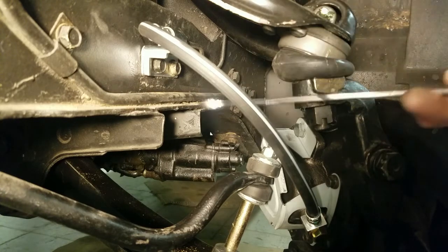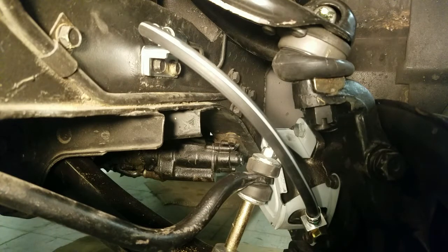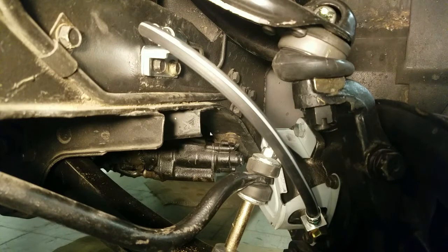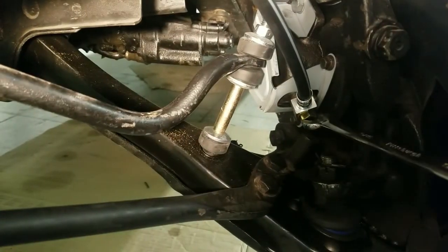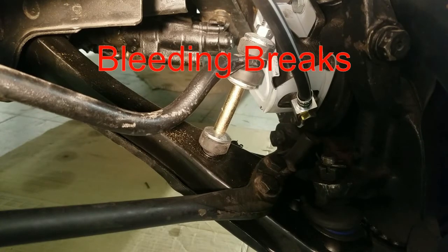Well, right now I've made sure that I've tightened that down, and that down. Those are both 1/2 inch into the frame. I used a 7/16 socket to get the brake line on there. And this down there is a 9/16 right down here on the brake line. That's all tightened up and good.